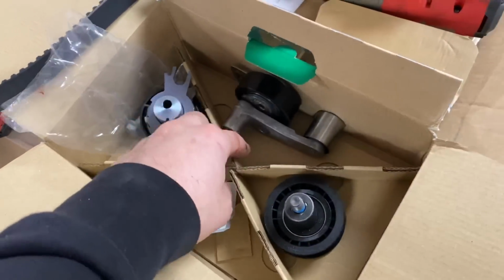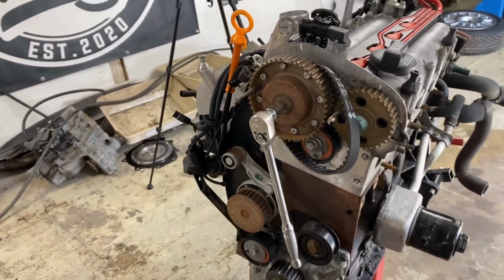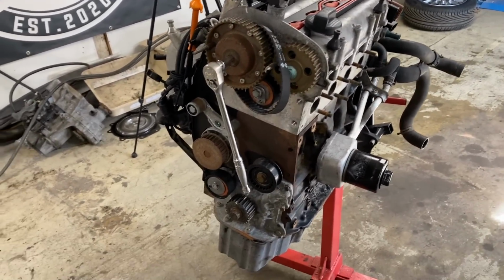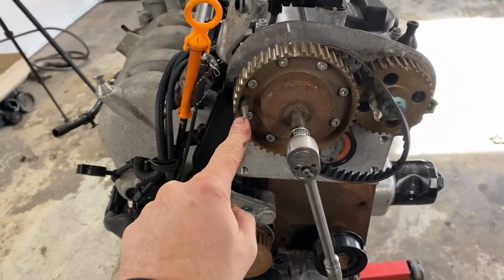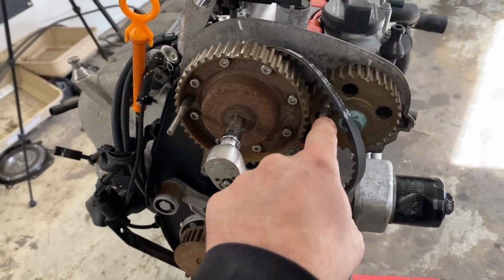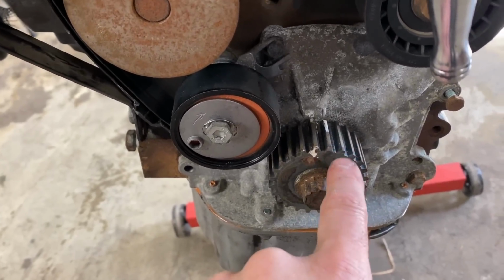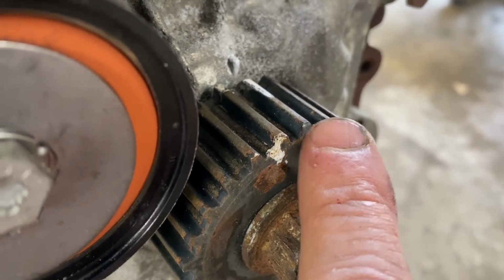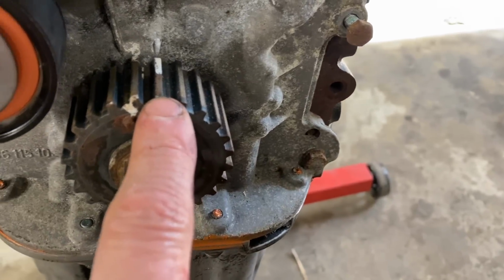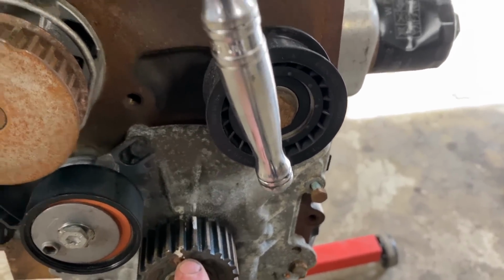And I've finally had delivery now of all the cam belt kit and everything. This is the little belt that is on here. So I'm not a professional in doing all this, but we've used 8mm dowel there and an 8mm drill bit to lock the top off. The bottom we have marked. Now you can see on this here, these are all square. This one's got an angle on, which notes which one has got to be, and there's a mark in the block there. So that's the bottom is now timed up.